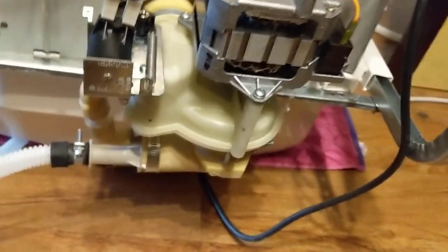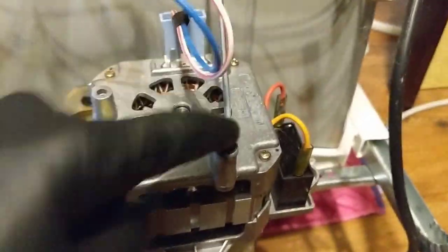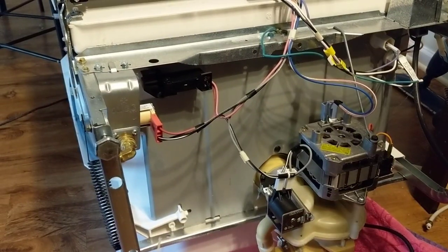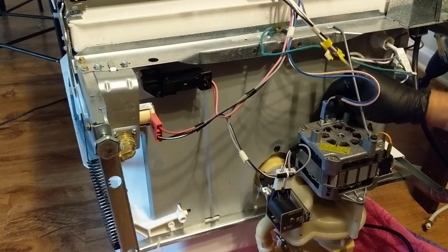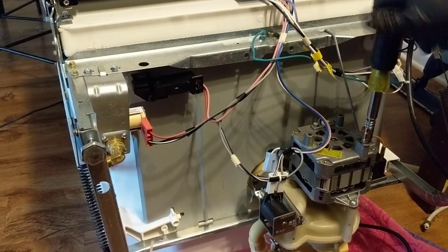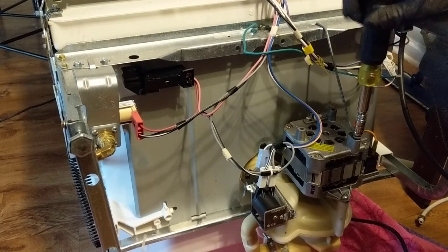And there's our motor. So we'll start with the clamps, pull off the wire harnesses, the bracket. Get everything unmounted, put the new motor and pump, which is right there. And unplug our harness, remove this clamp or this bracket.